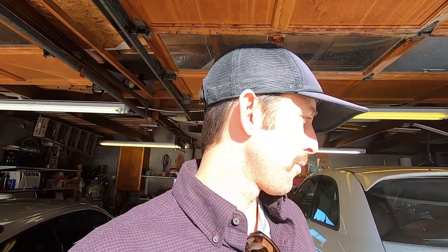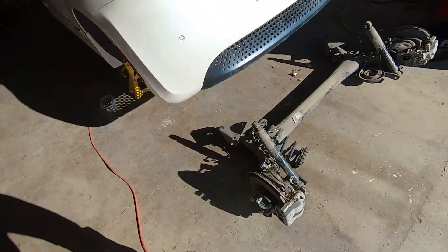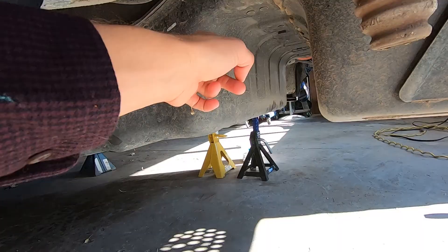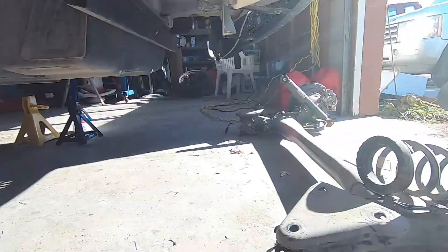What people have said might work is that you actually have to drop the high voltage battery pack, open it up, and individually charge the modules. There are 18 smaller batteries in there that all connect together to provide the big voltage — 350 volts in this car. So that's my plan today. We've already started: the rear axle has come out, and that's because the battery pack goes up and over where the rear axle was.